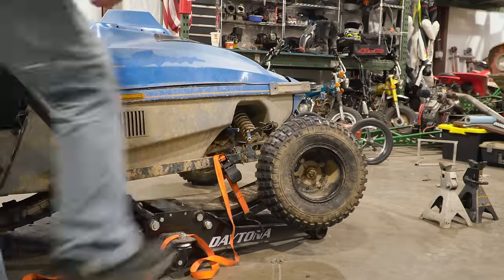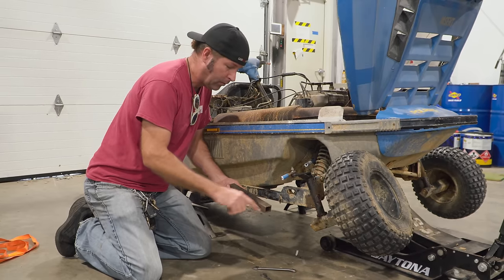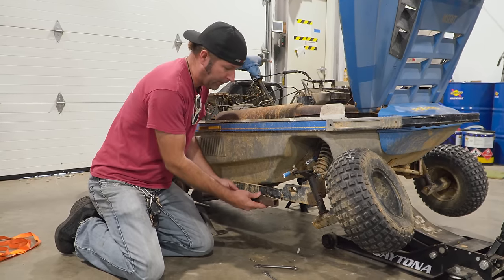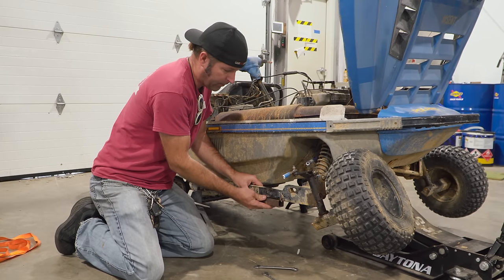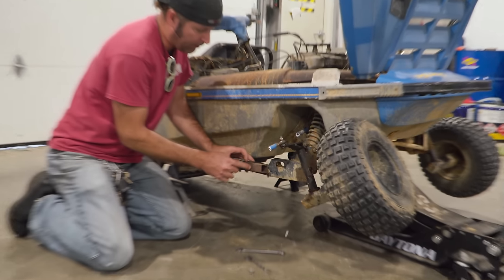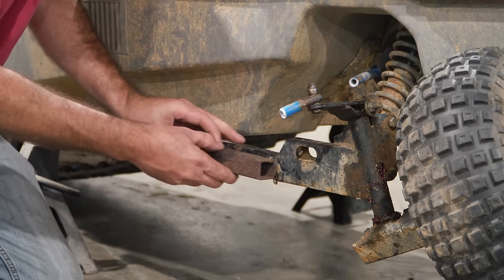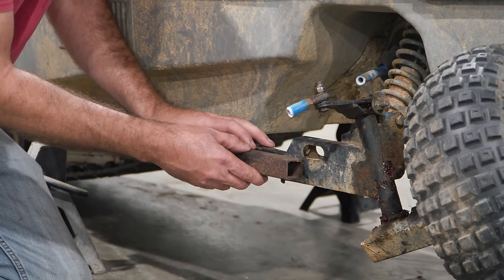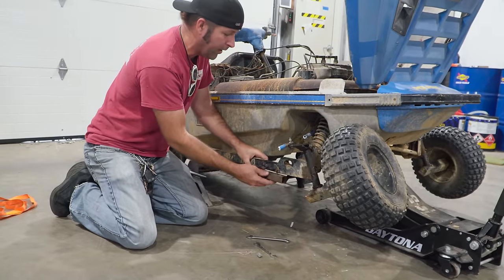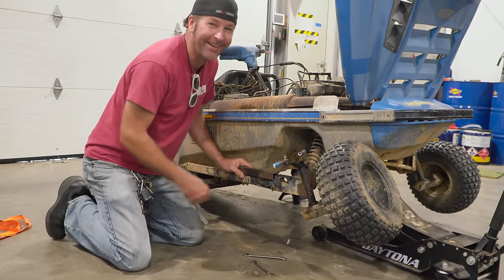So Charles actually found this pipe, and we are going to brace this thing up. Square tubing. I'm gonna cut the top out of this, which is gonna allow me to slide up from underneath. I'm going to trim out here a little bit so I can slide it forward, but it's gonna be butted up to that, and that'll allow a strip to be underneath that we weld up. You know what I'm talking about.